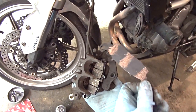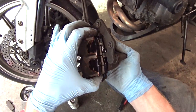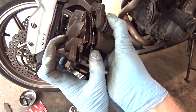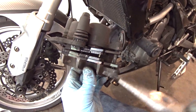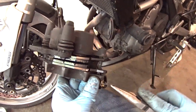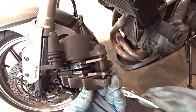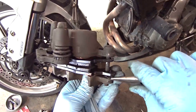So with that greased we come to the caliper. Slide it onto the pin, rotate the pad round, seat it onto the caliper itself and then we're ready to stick the pin back in. Take the pin, shove it through the caliper, shove it through the first pad, shove it through the second pad and then through the end of the caliper. As you can see that exposes the hole in there for this little spring clip to pop back into. The caliper does actually have a little shoulder here so you just need to find the smallest spanner in the world to rotate that pin so that you can get the clip into it and it's got somewhere to go out the back. That's that clipped.